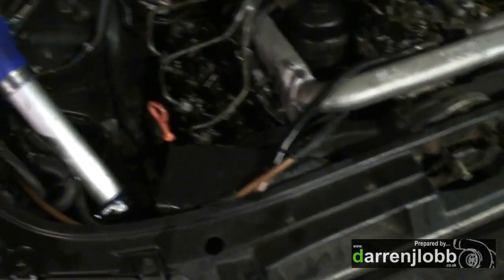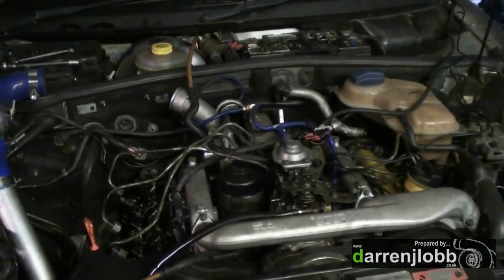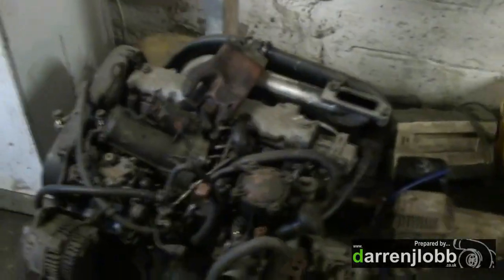Just a quick update on the Audi - just got that part again because we've got problems with the injectors. Well, we've got issues with it running out of balance, which I kind of predicted really, because we've changed the nozzles out in the injectors for some much bigger ones. With DI engines like this, the nozzles themselves pretty much immediately become restrictive, so I put some much much bigger nozzles in.